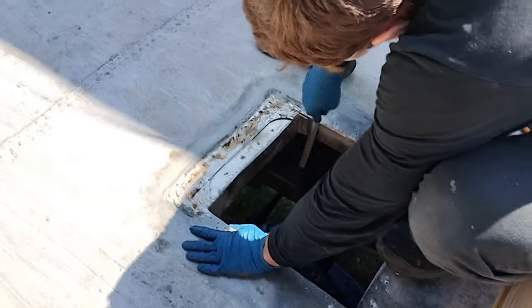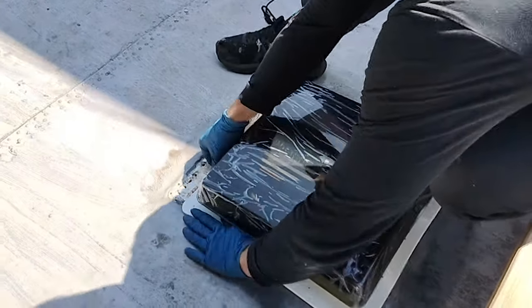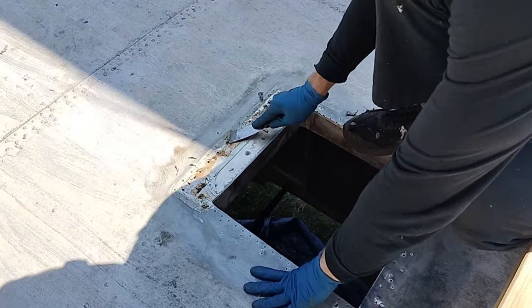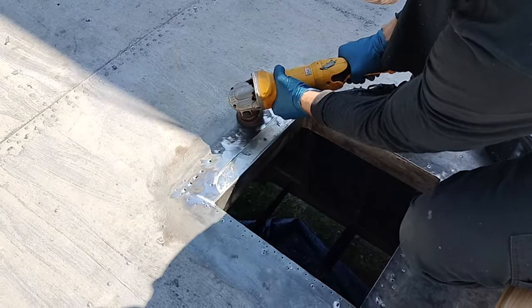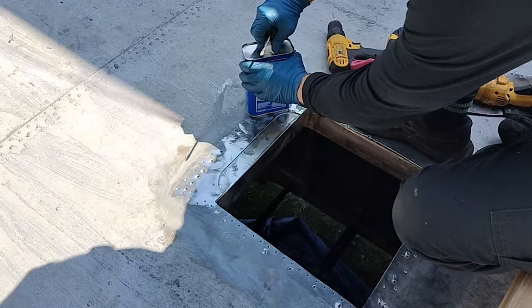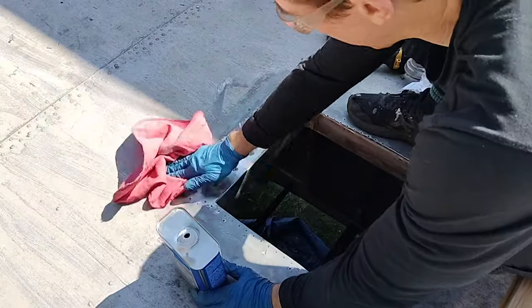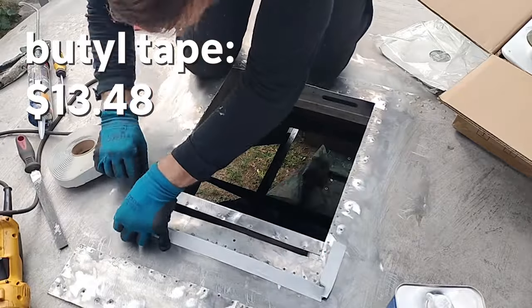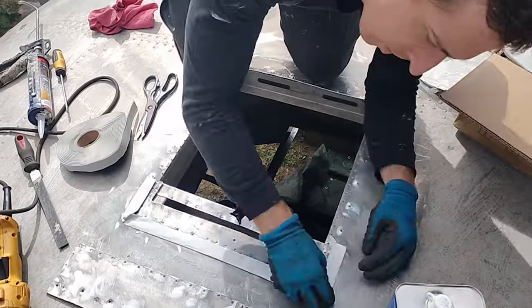So I've moved it — you can see that much. Let's file this down and see if the vent fits. At last. Final rivets. Cleaning up all the goo from the patch and finishing it off with some acetone.